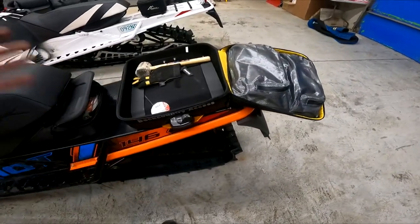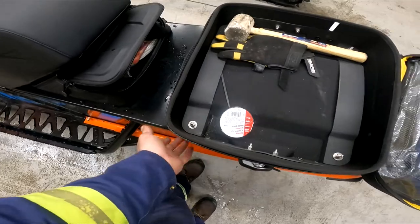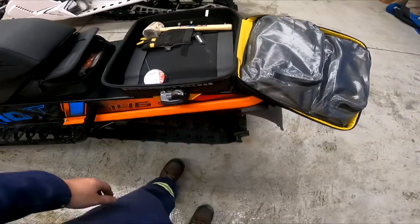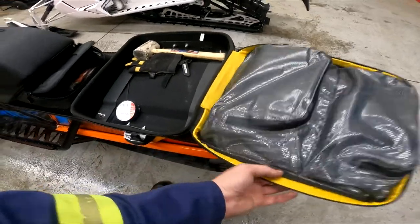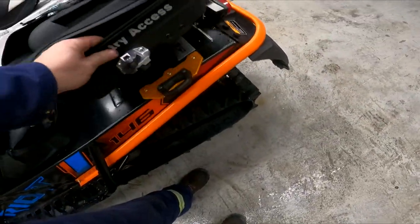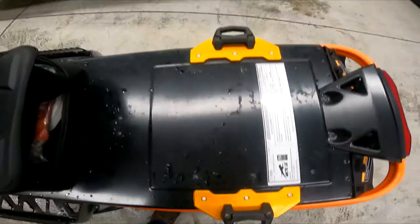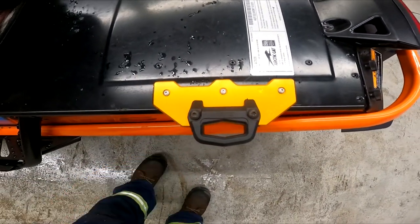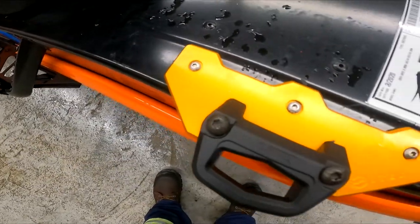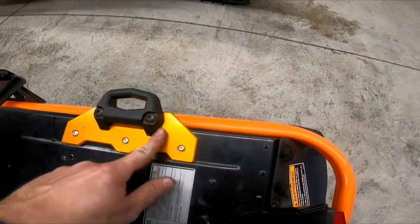You could ratchet those clips and attach them to your bumper to hold it on, but I don't think that's a very good system. A lot of people say to draw the webbing right through your tunnel so it's held on permanently — I get that, but I want to be able to remove mine. So I got the link setup. You need adapter plates; there are a couple different companies that sell them. I got mine from iTech — they're out of Montreal — so shipping and currency exchange just made sense. They come in different colors, nice CNC cut.